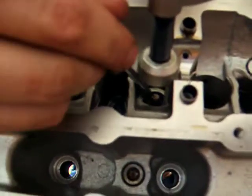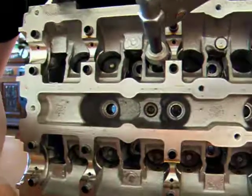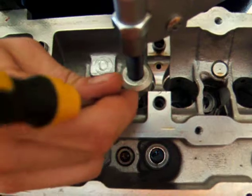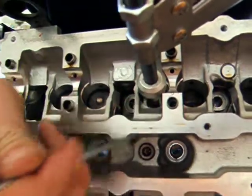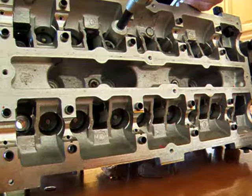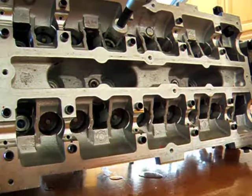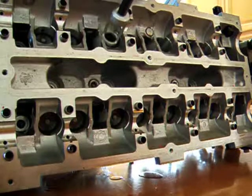And then I will take my screwdriver, which has a magnetic end, and this will take the collets off as you can see. The second one always seems to be a wee bit bigger. I will take this off — now this is where you have to be careful. It is handy to slack it a wee bit, a couple of turns, just so it is not so rough whenever it is being released. Because you do not want to score the walls. So I will take that off.